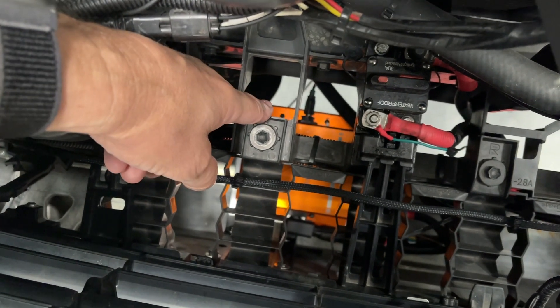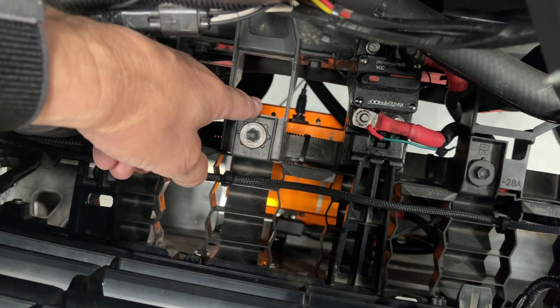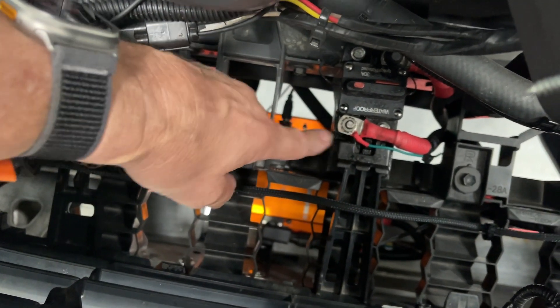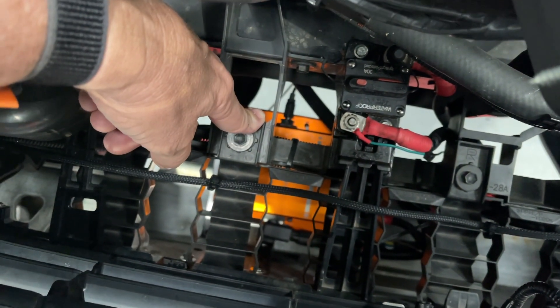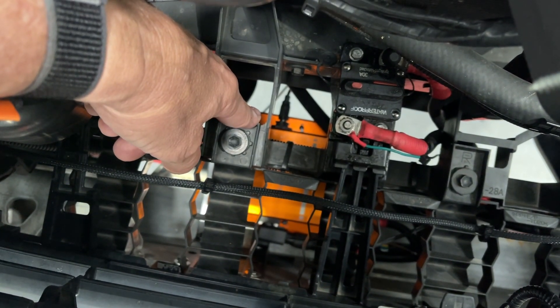It's down there now. It's IP66, so it can handle all the rain and water coming up against it. If you're going to do an actual deep water crossing, you want to turn it off beforehand — this is our control switch here. Turn it off before a water crossing, let it cool down a bit, and then it'll go straight through a water crossing, no problem at all.